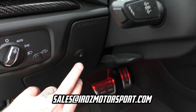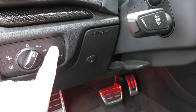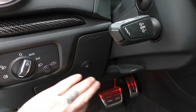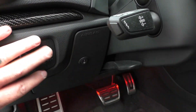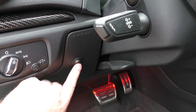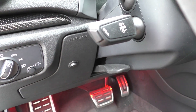It might not look identical to this, but this is a custom made piece by Rider Performance. I've also seen other people put their switches right here — they buy this extra piece, cut a hole in it, and have a switch there. Rider Performance and I both agree that it's better over here because there's too much going on over there, and when you're on the drag strip you don't want to accidentally hit something else. When it's up, it's on. When it's down, it is off and it's as if the power to the fuse has been pulled or the fuse itself has been removed.